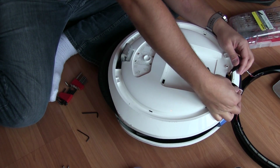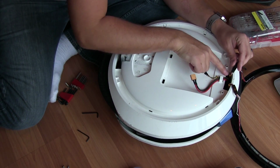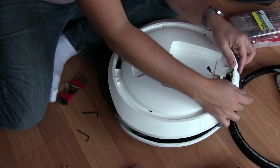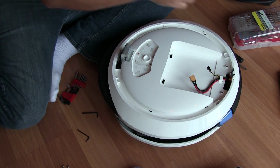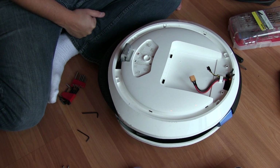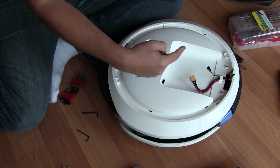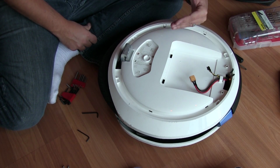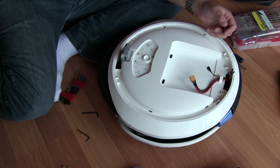These guys right here, these connectors, I'm going to disconnect them. This is for the light ring. When you hook this up, you've got a notation for 1 and 2. Make note, 1 should be plugged into 1, 2 should be plugged into 2. The light ring will still light up if you've got it backwards, but what ends up happening is that the lights will not coincide with the rotation of the wheel if you have those numbers backwards. So in other words, if you've got 2 hooked to 1 and 1 hooked to 2, as your wheel rotates this way, your lights will go this way. So you want to make note of that before you do a final button and assembly on this when we're done with this repair. Because ultimately you have to tear this back down again to this stage to correct that. There's no way to access these cables once this is all properly secured.